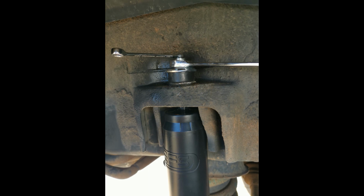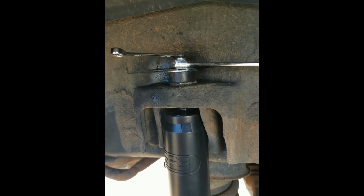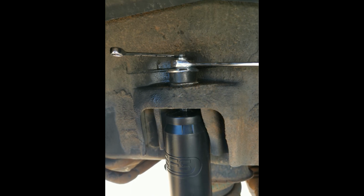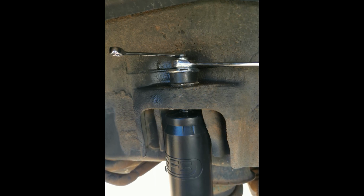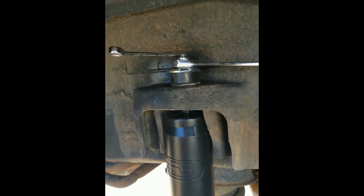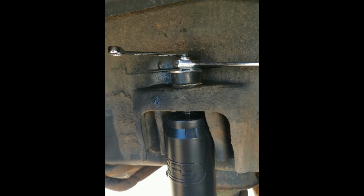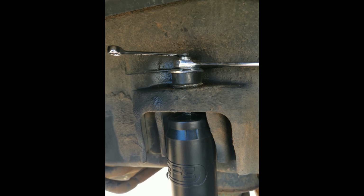If you keep tightening it, the rubber will just flatten out, and then it's going to wear prematurely. So just as a guide for the EFS on this, there's about 15mm exposed above the nut. So once I've tightened the nut down, there's about 15mm of thread sticking out past the nut, but that's just a rough guide. And then pretty much going to tighten the bottom bolts up. For me, it's just easily done with a rattle gun. So just make sure the other side, you'll have to hold it with an open-ended spanner, get your rattle gun onto the nut side, and then just send it.